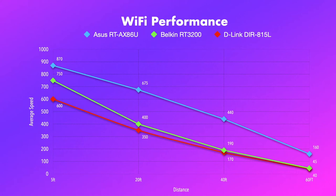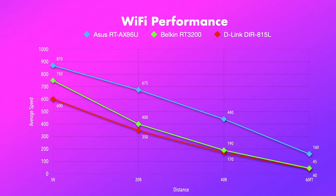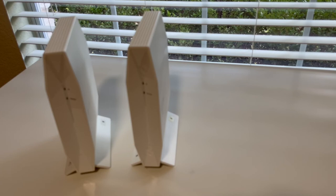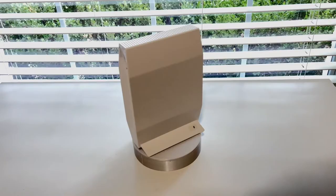All in all, the Wi-Fi speed is good at very short distances, say less than 20 feet, but the range is severely lacking. The router's Wi-Fi should be able to cover a studio or a one-bedroom apartment, but would struggle with anything bigger. The good news is since OpenWRT has excellent 802.11R Wi-Fi roaming support, you can add a second or even a third Belkin RT3200 and seamlessly extend the range — I tried this and it worked like a dream. Alternatively, since this is inexpensive, you can just use this as a router and add a standalone Wi-Fi access point which has better range.